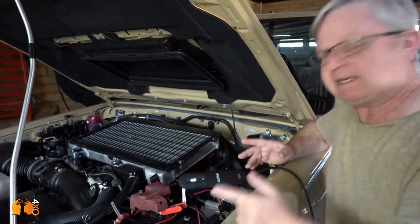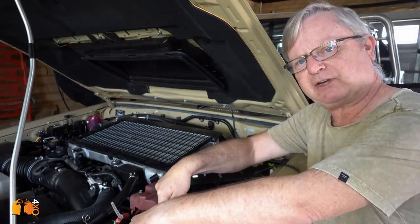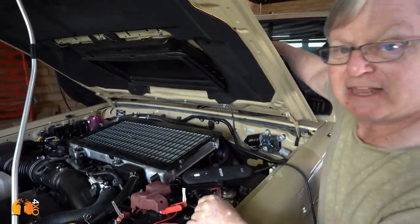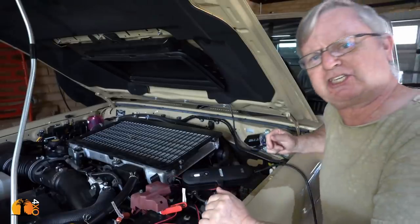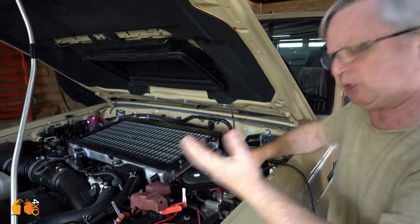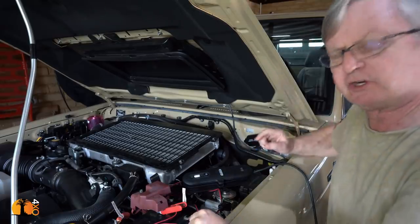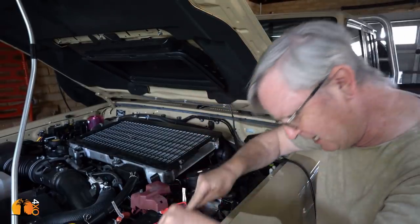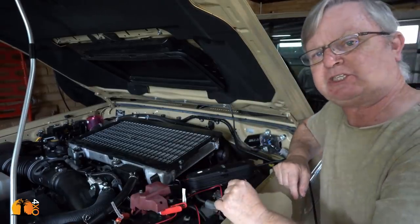What had happened is that this charger had increased the voltage across this battery and had started delivering its maximum capacity of 10 amps. The DC to DC in the back did exactly the same for those batteries — it started to charge them at 50 amps. So what did it do? Drain this battery. This was trying to cope but couldn't, because it was only up to 10 amps. Basically it emptied this battery to charge that battery first. So it will empty this battery, fill up that battery, and only then fill up that battery — which means a full discharge cycle of your car battery, and they don't like discharging like that.